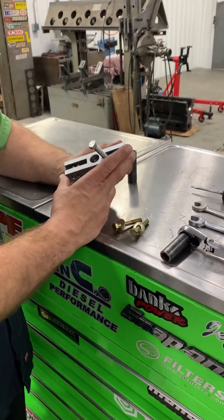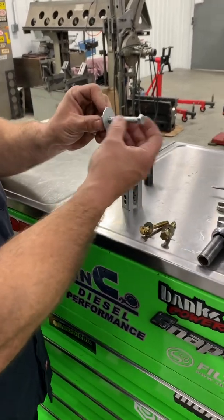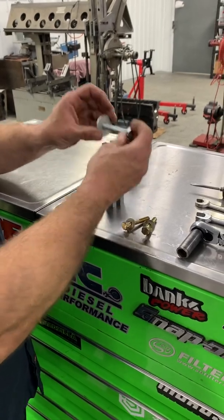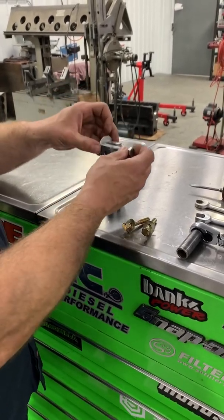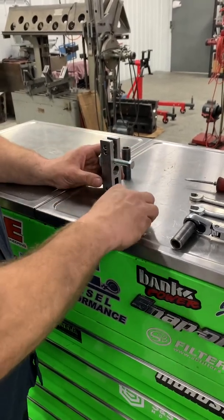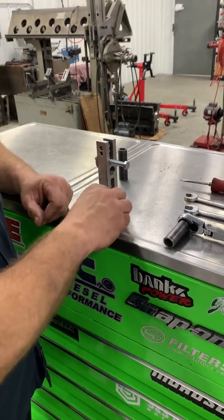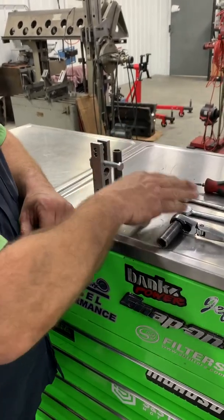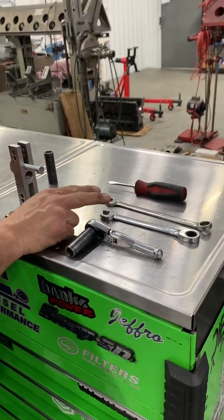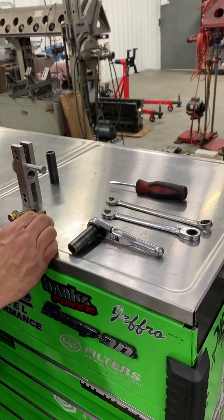This is about a 4-inch T-bar puller. We've got a 3/8 bolt — this is a full-thread bolt. You don't have to have full-thread, but it sure helps. This one's about 3½ inches long; 3 inches would cut it, and 4 inches is about the max length that would fit with the firewall. You'll also need a couple of 8mm by 1.25 bolts. In the truck you'll need a 9/16 wrench and a ratchet wrench; here on the demo engine we're using a ratchet with a socket.